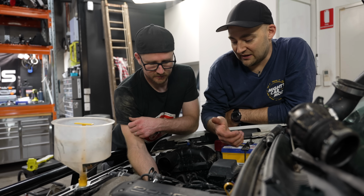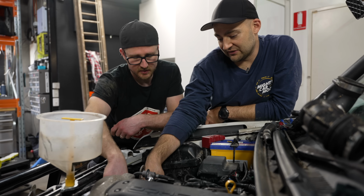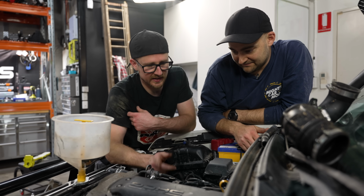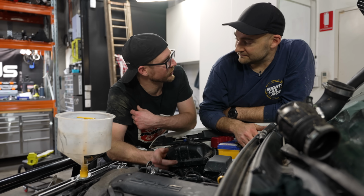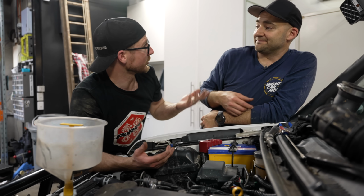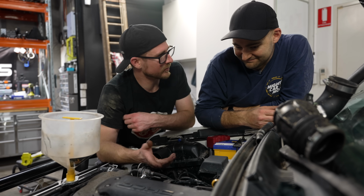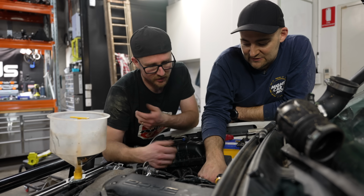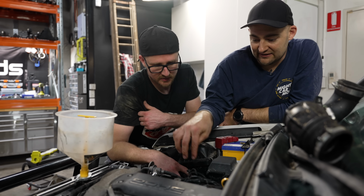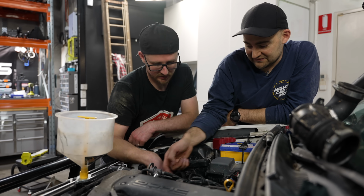So straight away I thought maybe we've plugged something in incorrectly. But even the factory hose on the M13, it's exactly that shape. And I know with some Honda things, if you use the incorrect intake manifold, you actually leave a coolant line exposed. On our Civic. On your Civic, yeah, right? Yeah. I'm concerned that could be the case with this, but when I did mine, it just wasn't an issue. No, it just went straight on. It's been done so many times, and there's no coolant in there, which means it's not getting into the head through the intake manifold. Because it would have poured down that way too. And it would also have to suck the water up.